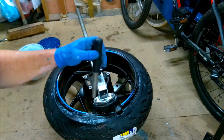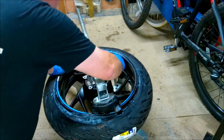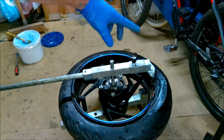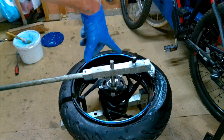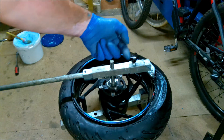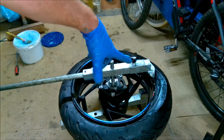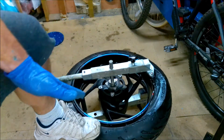Then you want a dowel - stick it in to stop the wheel turning around on the machine in the hole provided. Now it's time just to spin that round - that way - so the edge that's got the tire out is your back edge. As the tool goes around it leaves the tire out, but if you rotate it the wrong way as you go around it will just keep pushing the tire back in onto the wheel.